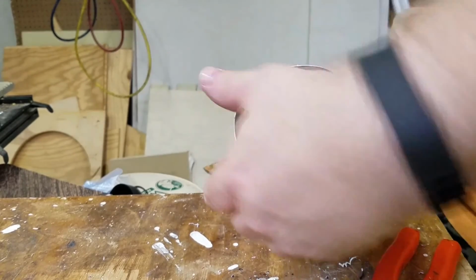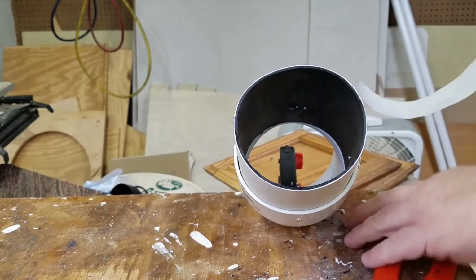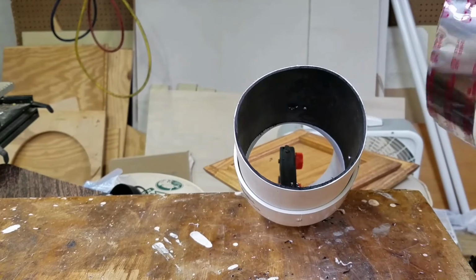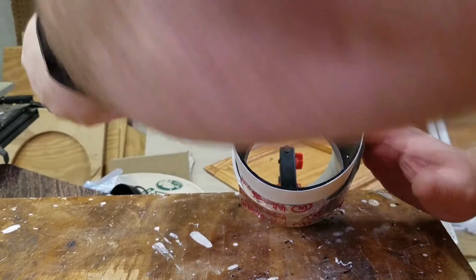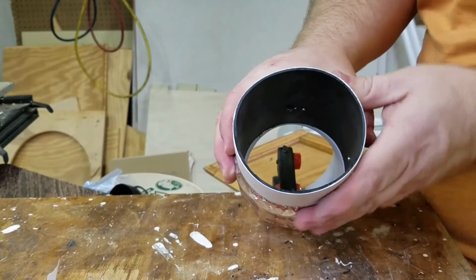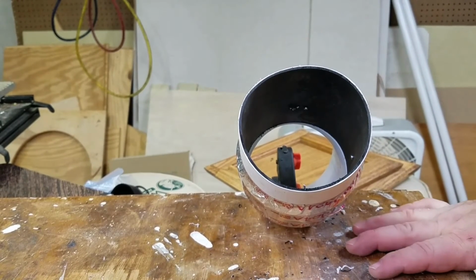Lastly, like I said, you're going to be sealing this joint up anyway. So my preference, and I'm not sure how I came about this, but my preference has ended up being using HVAC sealing tape. So you just go over the joint thusly and make sure you cover the rivets and the now abandoned hole with your tape. Smooth it on. There you go. One smooth riveted joint.